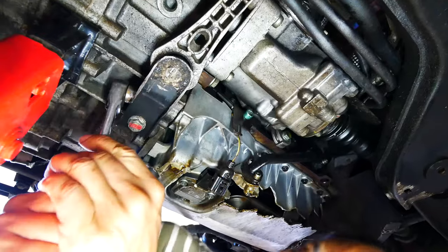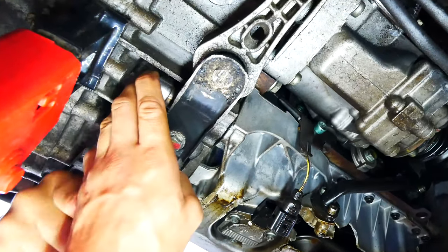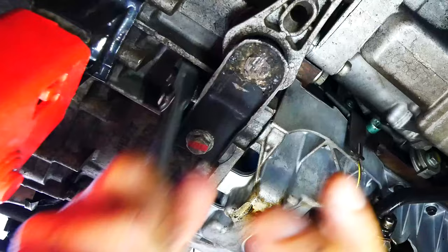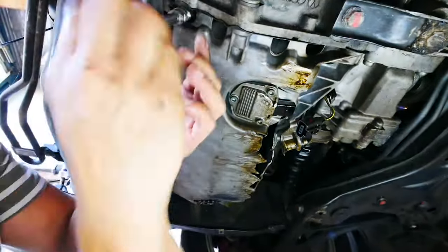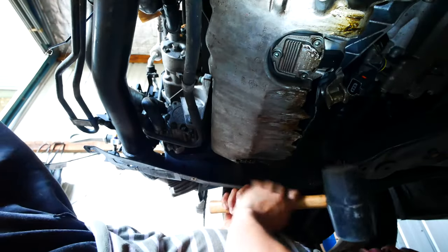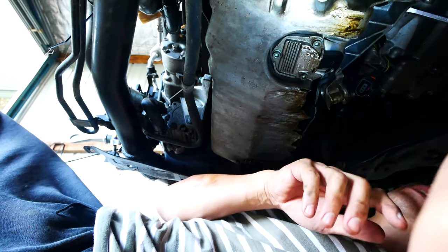This one here is just a 16mm. There are three of these 16mm bolts that need to be removed from that side of the gearbox. Once that's done, remove all the little 10mm bolts in the perimeter of the sump. Honestly, I don't care what happens here because as long as those plugs and sensors are fine, the rest of it can be broken — it's pretty stuffed anyway.